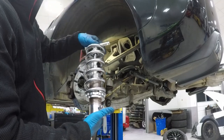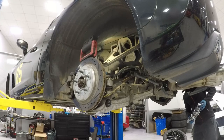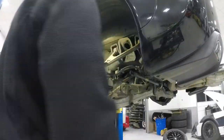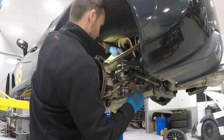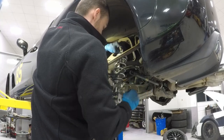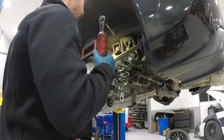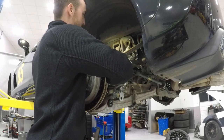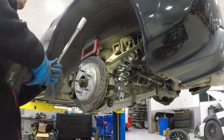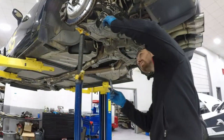I'm going to compress this down just to shorten the length of the whole assembly to make it easier to get in. Making sure the long side of this mount comes out towards the outside of the car. Slide it up through - we'll Loctite the end of this too. Pretty much Loctiting everything because I don't want anything to back off.